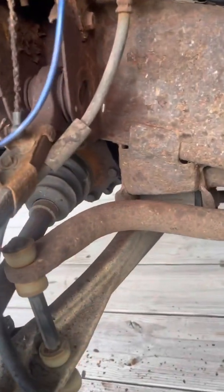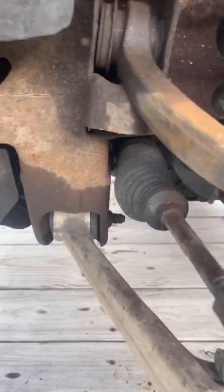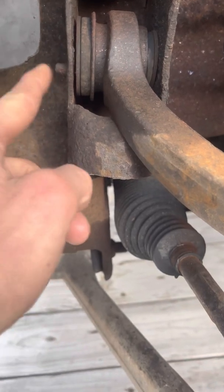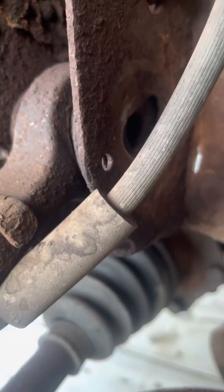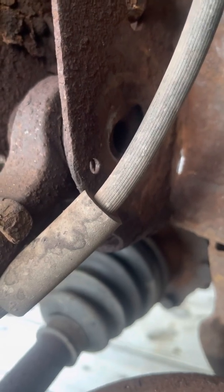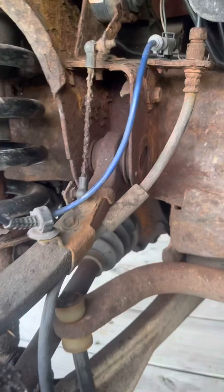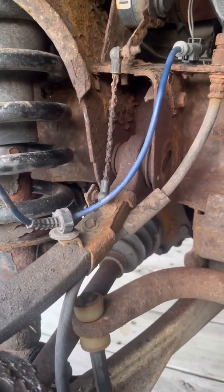Has never done it yet. But I did find out when I was taking the rear bolt out that this little camber alignment nub that the groove goes into is missing. I'm guessing it's from the control arm sliding back and forth in there, so I'm hoping one of the local auto parts has the Moog kit that I found online. If not, I'll have to order it before I put it back together.